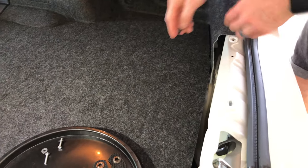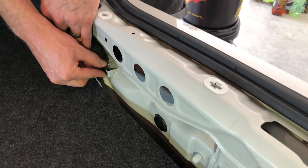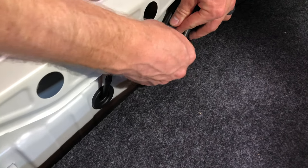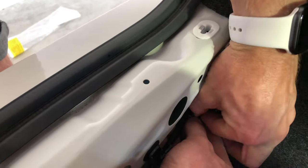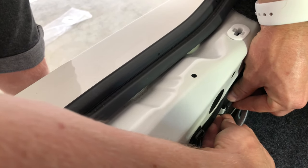We've got two more U-clips to attach down the bottom as well. You'll see right at the side of that trim piece removed we've got two more to attach — again that way in. These have a tendency to slip; you don't want it to go all the way down or you won't be able to thread the bolt through. So we've got the second clip to piece in — just peel that back again, flip it around, and you want the holes to line up. This one's actually slipping a bit so I'll try a different piece — it's a little bit tighter.